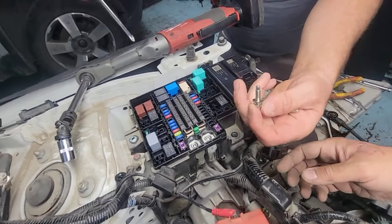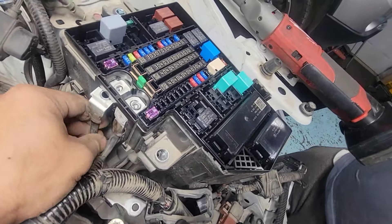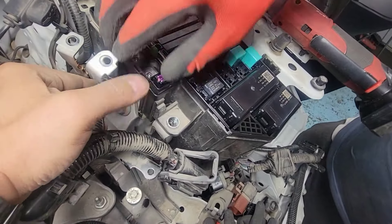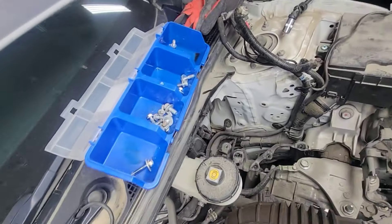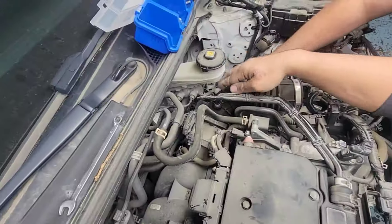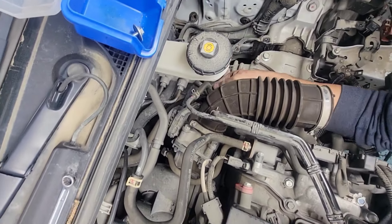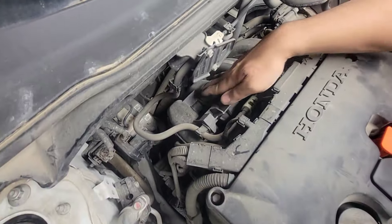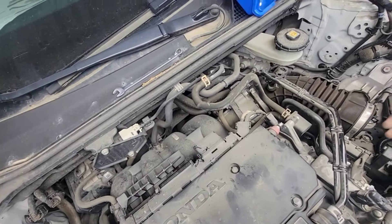Finish it off with a screwdriver — take out that screw, then pull the cable out, same thing on the other side. There are tabs holding it in only one way. This whole harness goes with the engine. There's also a ground right here — take out the 10mm on the ground. At the back of the engine it's going to be tough. There's an inlet and outlet heater hose, a vacuum booster hose, a purge solenoid that needs to come out, and a few more connections. We're going to fast-forward through everything down here.